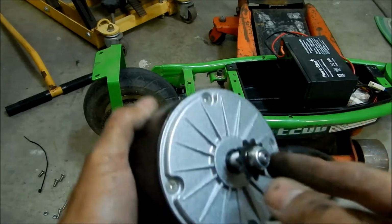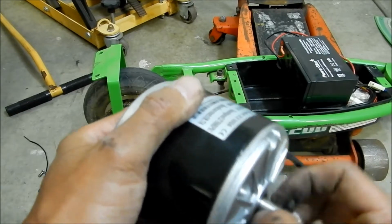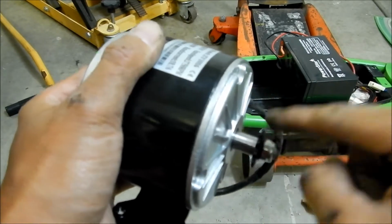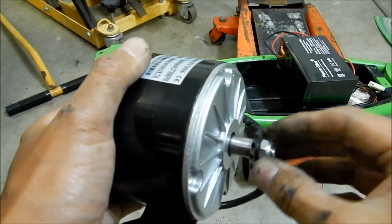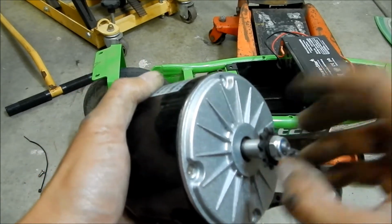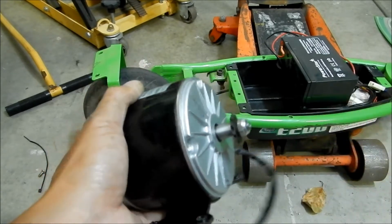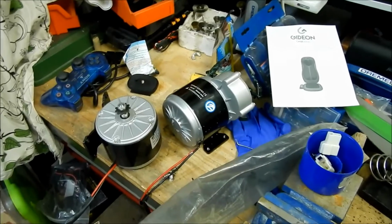So anyway, we're going to get this nut out of here, pull the sprocket out, and then I think there's a spacer right here on the shaft that gives you the length. Then all we've got to do is probably cut that in half and push that sprocket in. Hopefully there's enough threads in there to do that too. If not, we may have to make another spacer for the other side too. So this is a lot more work than I bargained for.